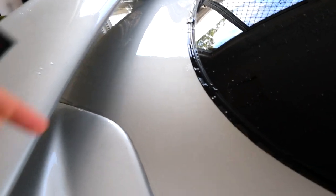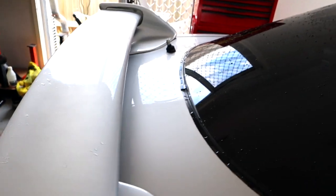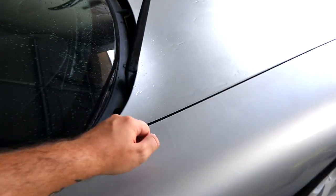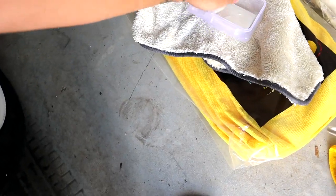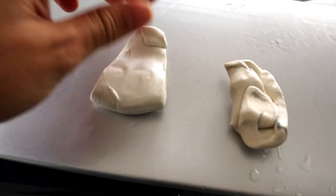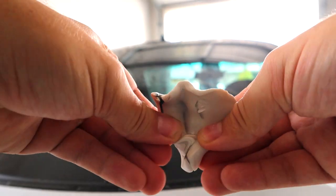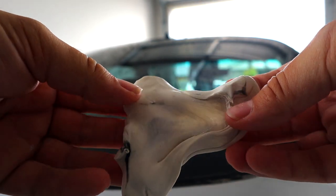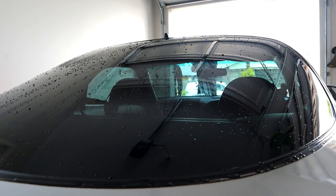The car's back inside now. It was actually pretty good outside but after you take off all the layers of whatever is on here, it really starts to sheet up. One of the main reasons I decided to do a clay bar on the entire thing is right here - this is my old clay, slightly discoloured, compared to this brand new block of clay. You guys can see just how much crap is in there, and if I start unfolding this you can see how much gunk is in there. We don't want that being polished up through the paintwork.